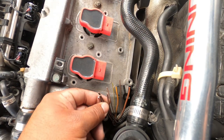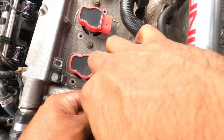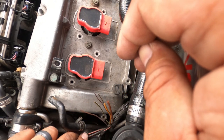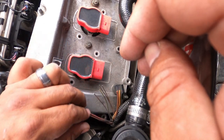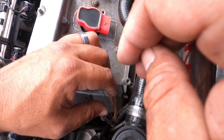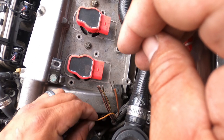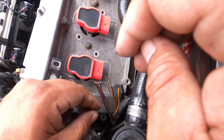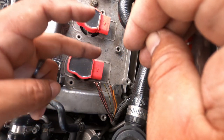See these four that Rob's holding? They're black with a purple stripe. These four don't matter what order they go in on the pigtail - they're your top row. These four right here are your cylinders - very important. And then there's the brown one which is a ground, and this peachy yellowish brown one - that's your other signal wire.